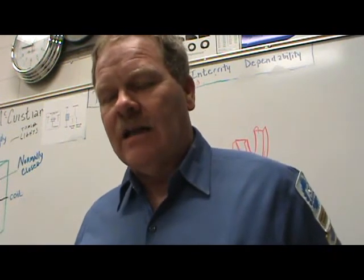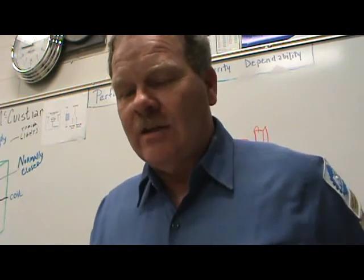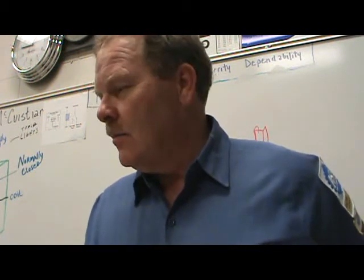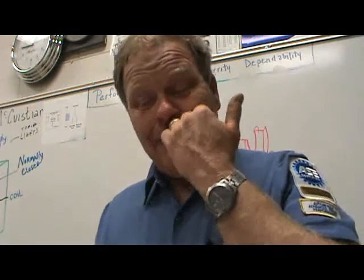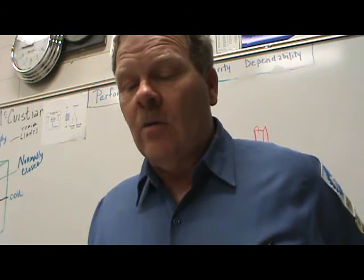Actually, I like that first answer. I like what Technician A said: when loosening head bolts, you should use the same sequence as the tightening sequence if the sequence is not specified. Now, see, that's number 11. They're claiming that he's not right. I kind of like that because it keeps you out of trouble. There's nothing wrong with using that.